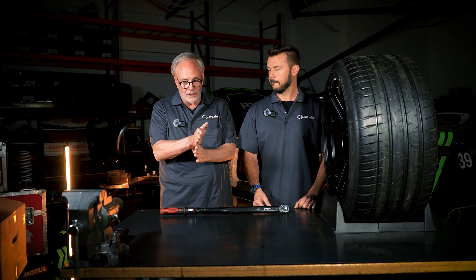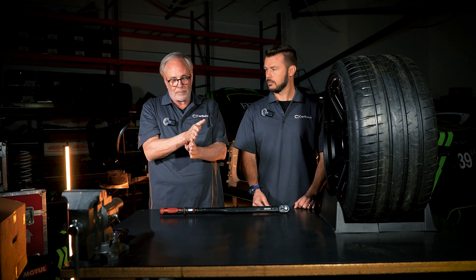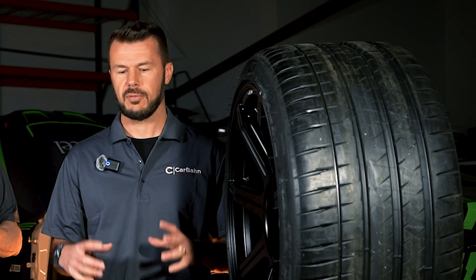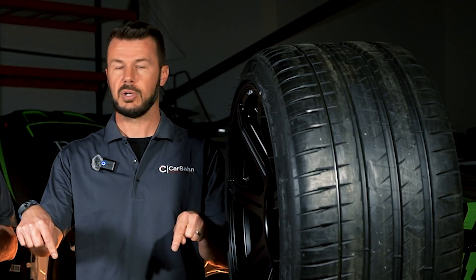If the points were right on top of each other — this is what they do with front-wheel drive cars — they put the two imaginary pickup points where they hit the ground in the center of the tire. So when you step on the gas, it doesn't torque steer because you have no leverage. Because front-wheel drive cars are driven forward by the front wheels, which are also doing the steering, so you have a hundred percent of the car's movement happening on two tires, not four.